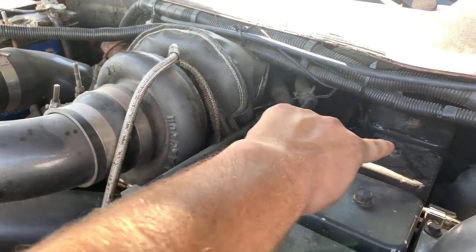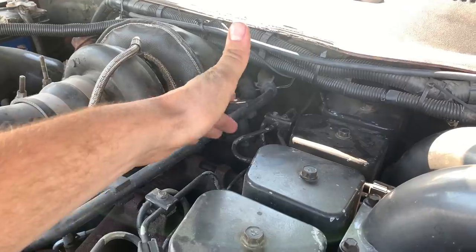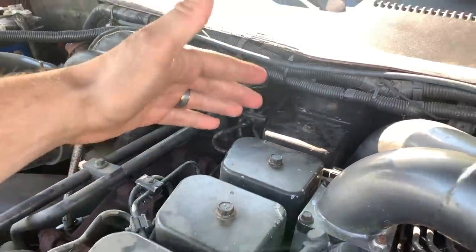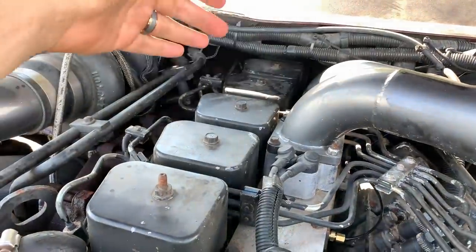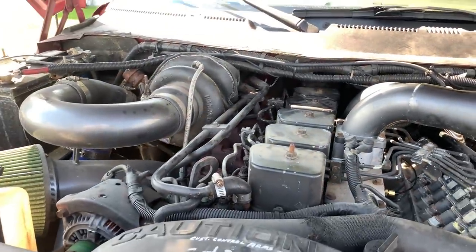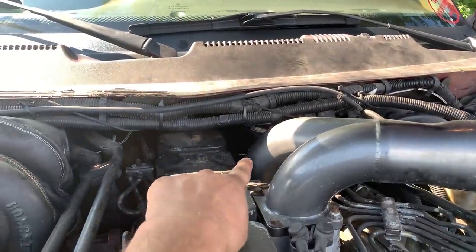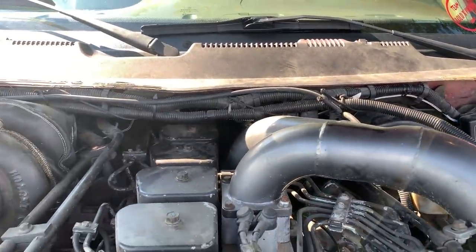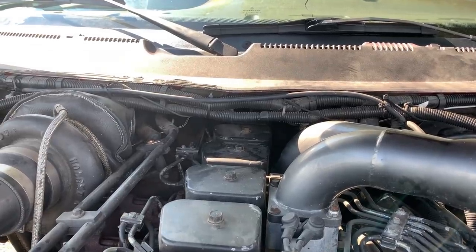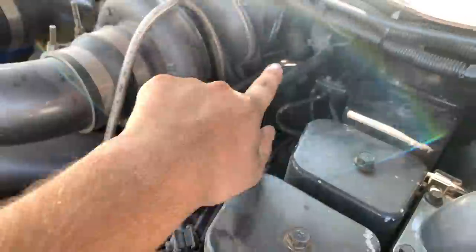I think it's more like directly across from cylinder four, but the reason it's placed back there on cylinder four is because typically, statistically speaking, cylinder six is obviously going to get the hottest, six and five. Usually it's because of the disposition of airflow into the engine, but on this truck we have the mega twin, which pushes air directly back towards cylinder five, specifically to try to cool the back faster. It's hard to see, but it's right behind that turbo blanket right there.